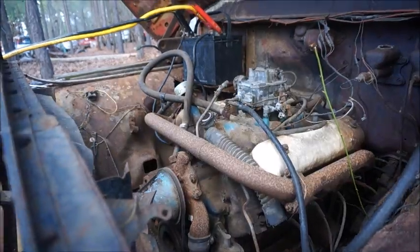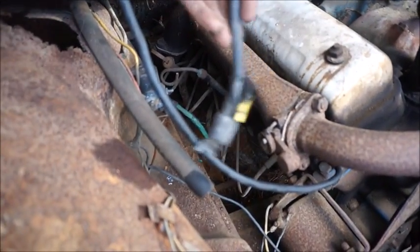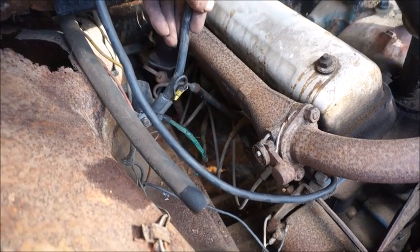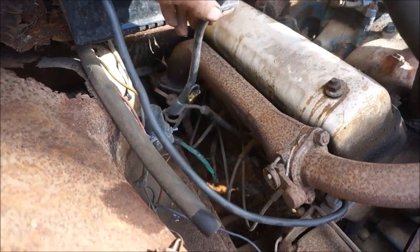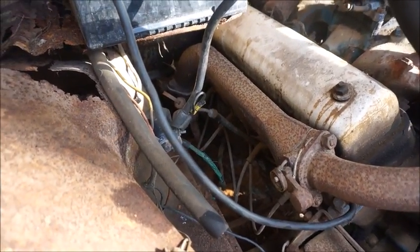Okay, I think I found what our major problem was. This wire I used actually had a lead end on it, and it melted off, got hot. So we'll change that out. Good heavy cable, but the lead got hot, so we'll see what we can do.